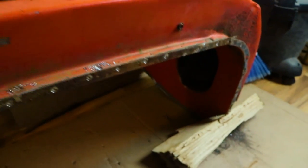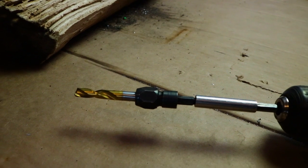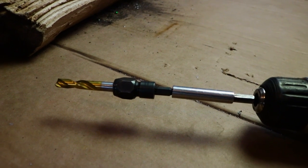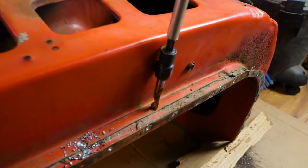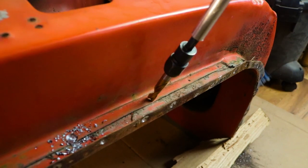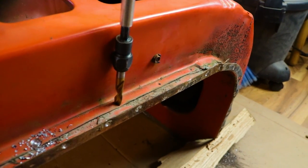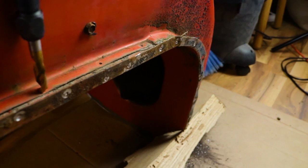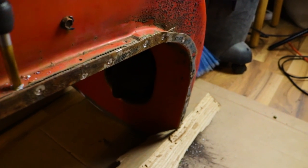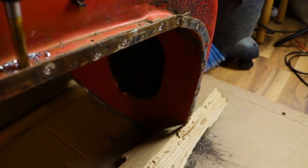Here's one tool that is a must — you're not going to be able to do this job without a spot weld cutter, and also without some kind of extension for that spot weld cutter. As you can see, if I didn't have this extension here, my angle would be like this, and you're never going to be able to cut that way. This one cost me like 7 or 8 bucks on Amazon, so it's actually a pretty decent deal. It could be a little slimmer, but it definitely does the job. If you guys are interested in this, I'll throw a link in the description.